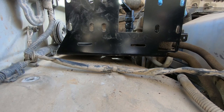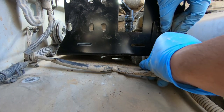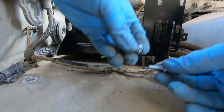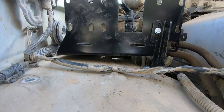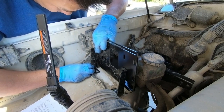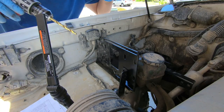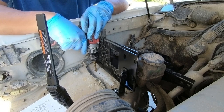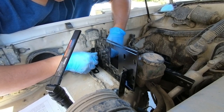Here's the front of the tray — power steering reservoir is right here. Next we need to install the leg bracket: this guy goes into a hole right here and we screw that in loosely, then there's a bolt and nut they provided that goes in. So that's your leg right there. For this last leg, the instructions say you need to drill a 5/16th inch hole — small pilot hole first, then the 5/16th hole. We put the leg back in and hopefully the holes line up. It kind of lines up, not too bad.